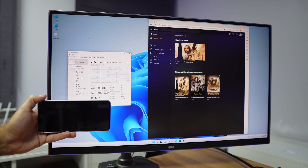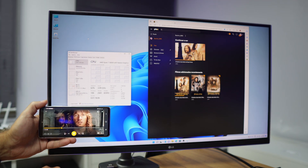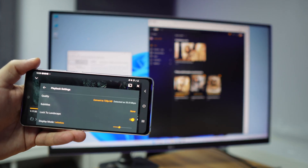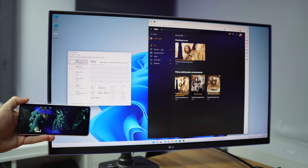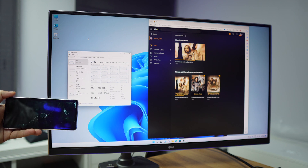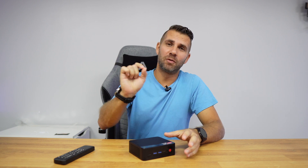Transcoding means the server picks a 4K or 1080p movie and converts it to a smaller format to pass smoothly through the 4G connection. That's where we feel some impact on the machine. As you can see, on the AMD 5800U there is a spike initially when transcoding starts, but after a while it normalizes and drops down to 20 or 10 percent usage — no issues whatsoever. For three or four people outside your network, it's just awesome.